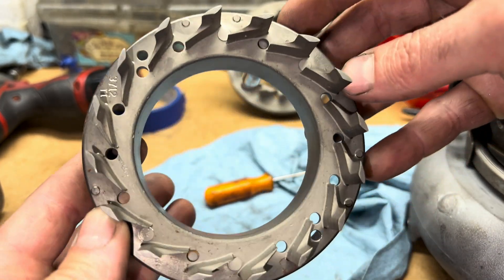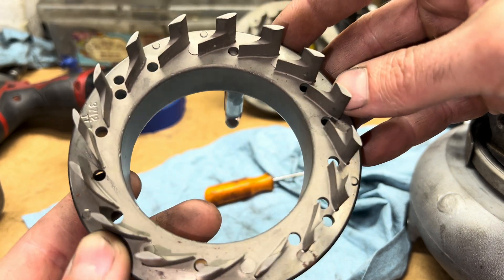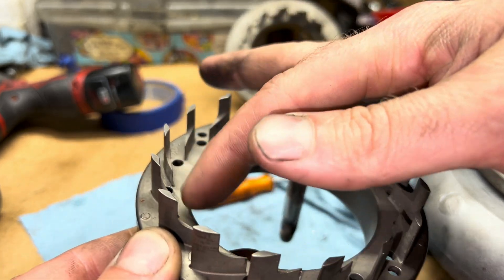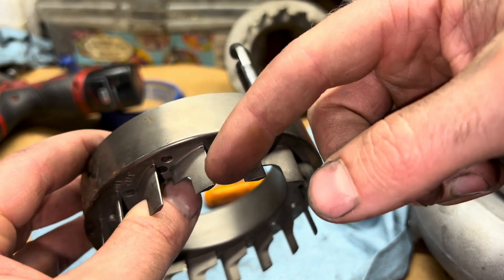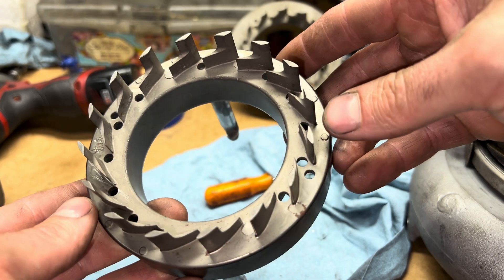What happened with this is something went through the exhaust — most likely a piece of the engine blew up or something — came through the exhaust and then just jammed up in the VGT, beating it around constantly. Usually what happens when they start jamming, the backside of these gets rough and they need to be filed down. A lot of times you can salvage the original unit.